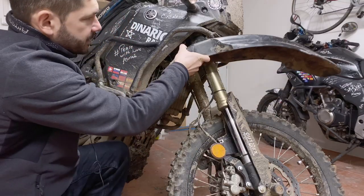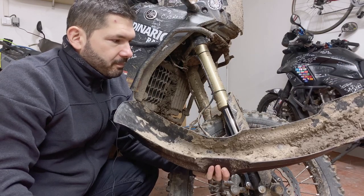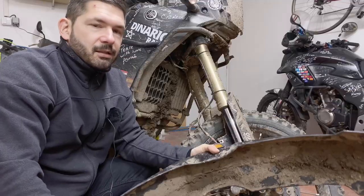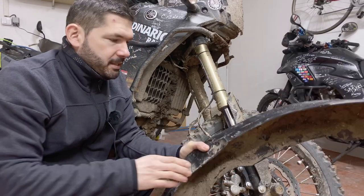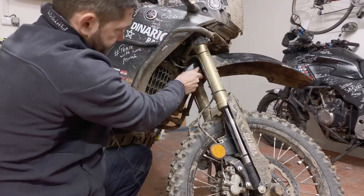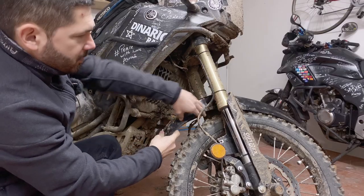There's a lot of mud in here because as it sits much longer, all the mud flicked by the tyre is captured by the fender and it's not going to fly to the front and back onto the rider. There's still some mud that will hit the rider more than with the low fender, but it's manageable. Another good point about this fender is that because it sits around here and goes quite low, it protects the radiator quite well.